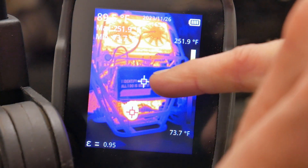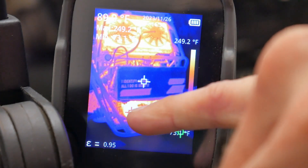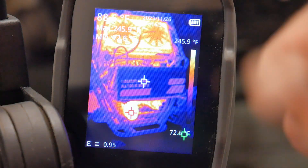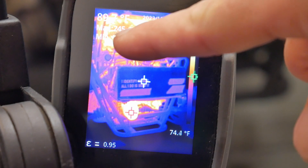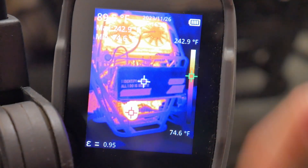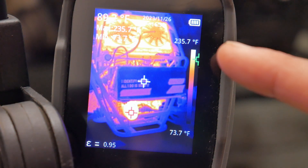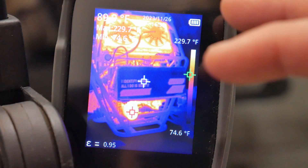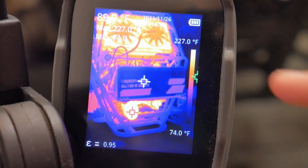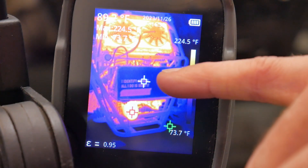Where the white target is, that's taking the top temperature reading — 89 degrees. The maximum temperature is this little target over here showing currently 245-246 degrees. The minimum temperature is scanning over on the coldest side of the screen. The engine has been running for one hour exactly. We'll reset this, let the engine get completely ice cold back to the same starting temperature, then remove our heat shield and run the same test to see what temperatures we get.